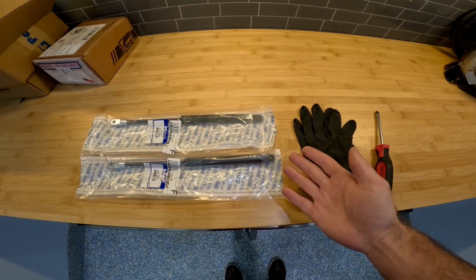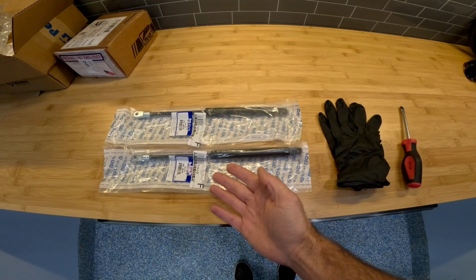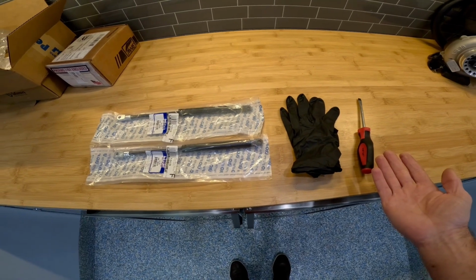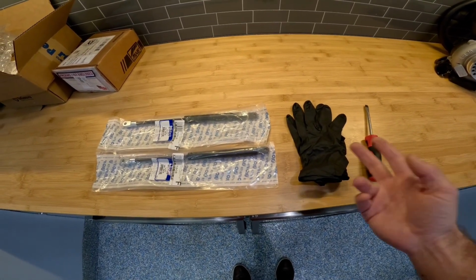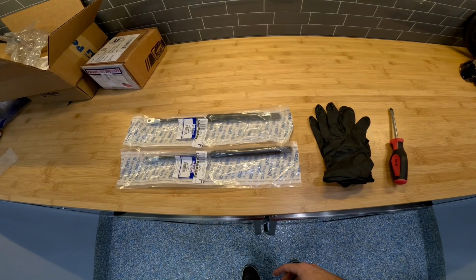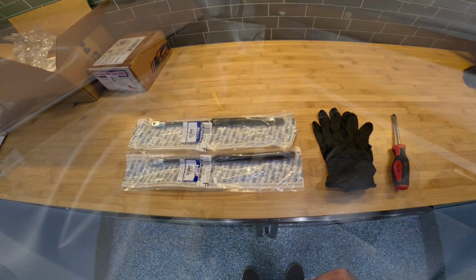Here are the hood struts that we received from Pelican Parts. Part numbers will be in the description. We've got a couple black nitrile gloves and a simple screwdriver. All we're going to be doing is removing two clips on each side that go here and there, removing the hood struts that do not work, replacing them with these, putting the clips back in, and we're done.